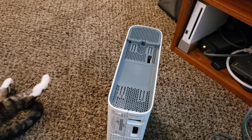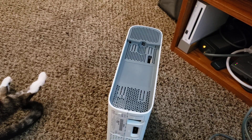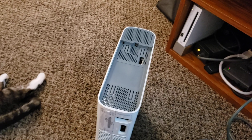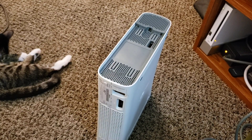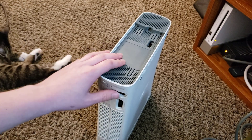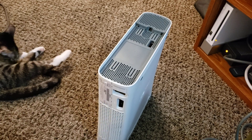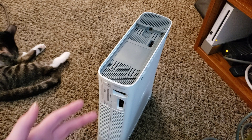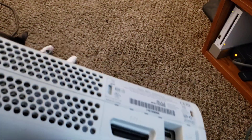The Falcon and Jasper, as well as the Opus since it's basically a Falcon, are the ones you want for actual usage because they're much less likely to have issues with the disc drive, scratching discs, and most notably less likely to get the Red Ring of Death. I wouldn't recommend using an Opus for gameplay because there's no HDMI, which reduces versatility unless you're playing on a CRT where you don't need HDMI anyway.